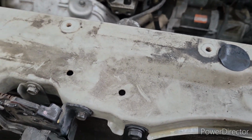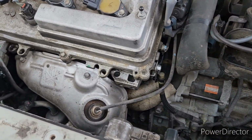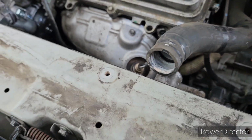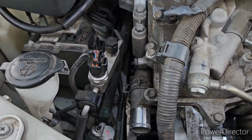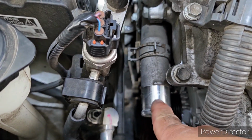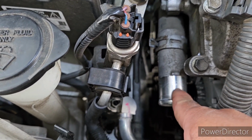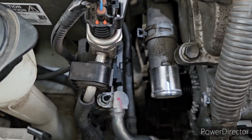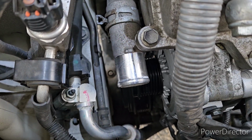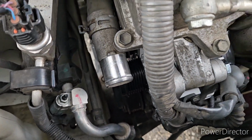Once you remove those screws holding the condenser to the radiator, you need to remove this radiator hose. Remove the clamp, and there's also a clamp there at the bottom. There's a clamp at a radiator hose here. This clamp here, you need to remove this clamp. Then you can disconnect the radiator hose here, and the hose that goes to the bottom side of the radiator. Then remove that radiator hose from the bottom of the radiator. Then you can pull now